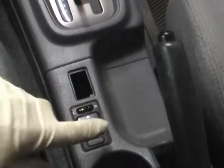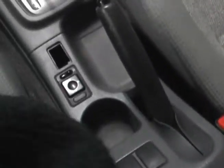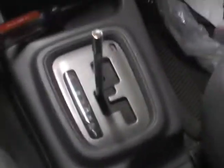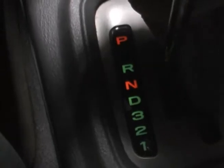Basically we just take this middle piece, put it over the emergency brake, get those little two pegs lined up in the back and in front, then just push everything down and we have this piece back in. This little decorative piece fell out — I've got to find that and stick it back in. Basically that's it, and we now have the light fixed. If we turn the lights on and make it dark, you can see we've restored the shifting lights. That's how to replace your bulb.